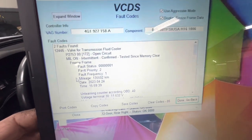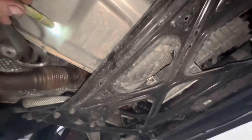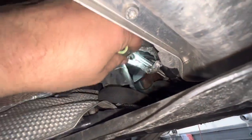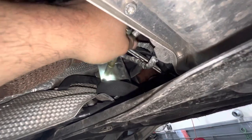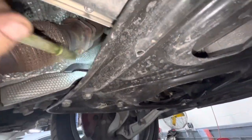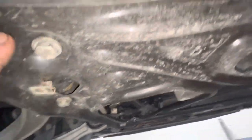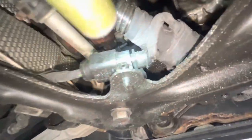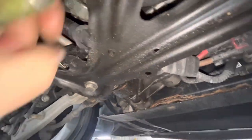Here's the transmission — right next to the transmission on the driver's side you can see a little heat shield. There are just two bolts that hold the heat shield on and they also hold the valve in place. Use an 18mm socket and pull this plate off. There are eight screws altogether — pull those off, undo the little clips, and disconnect the harness with a small pair of pliers, squeeze those fingers and pull it off.